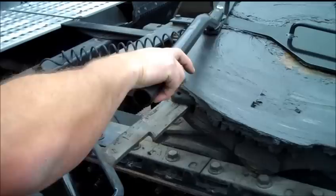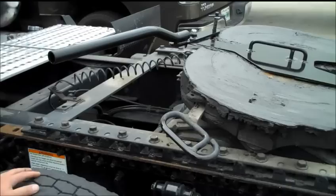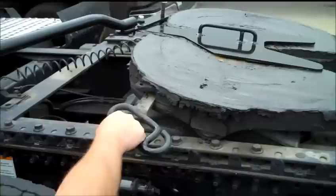If you'll notice on the 5th wheel, it has a secondary lock that's incorporated into the handle. When it goes down, it locks — it goes down in behind the casting, which makes a nice straight pull handle.